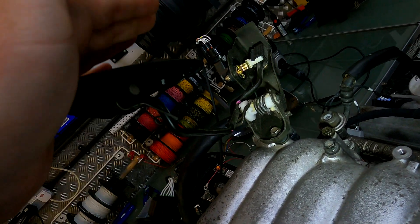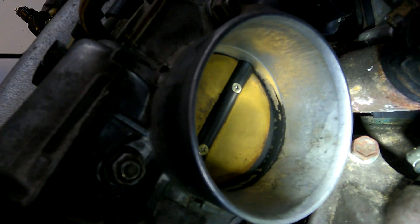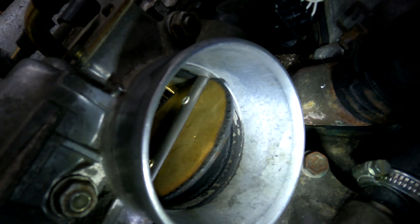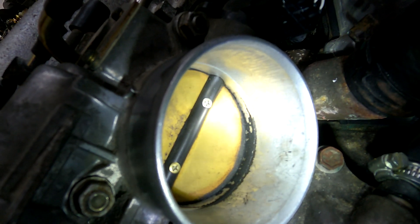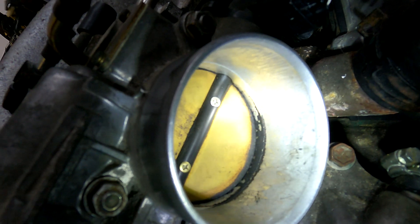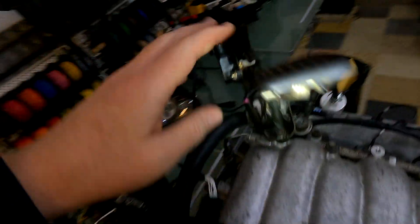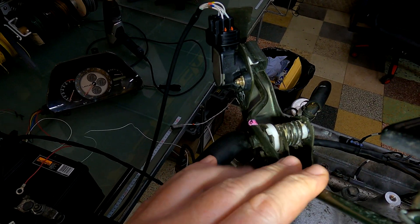So if you go all the way down — boom — you can see I've got the pedal all the way down, and then what happens is the throttle shuts down and it won't work again until you recycle the actual ignition. So I'm going to do that now quickly — recycle the ignition — okay, everything is on. With this pedal hooked up, open, open, open — and there it goes straight too far again.